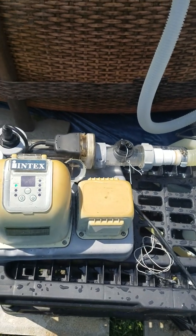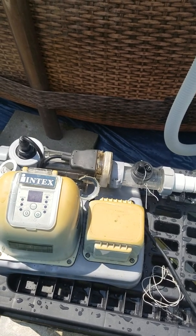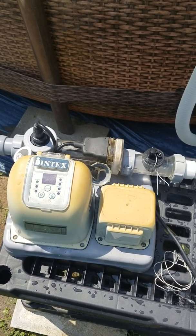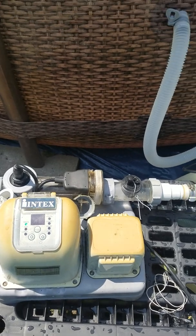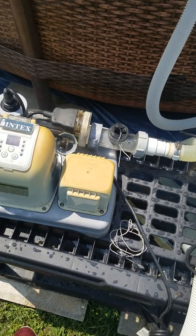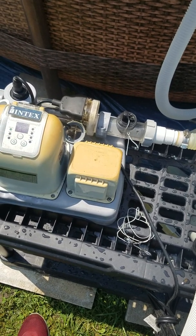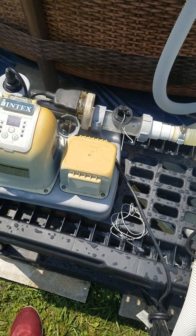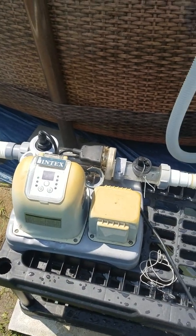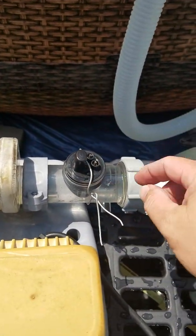If you see that little green thing in the water line, that's the end of a zip tie I jammed into the hinge to keep the flapper from dropping, because even with good flow it kind of wiggles a little. To test the reed switch, I placed that zip tie end in the hinge to keep it flat up against the switch body. I did check for the magnet — the magnet is present. Sometimes they begin to rust and come out of the little plastic piece, but that hasn't happened. I used a screwdriver tip and it's good and magnetic, so it should be actuating the reed switch.